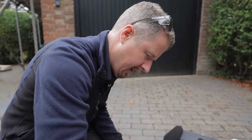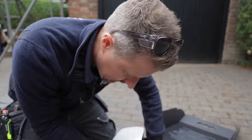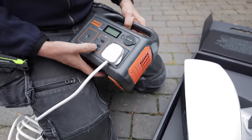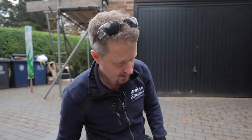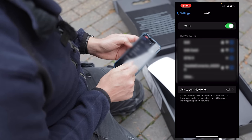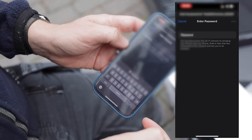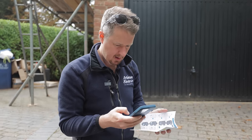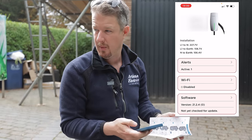What I'm doing here is putting it on a plug top so we can liven it up temporarily to do the wi-fi setup, because it has been known to be a nightmare. We've got this portable power station — obviously not enough power to charge a car, but enough to power up the unit and get it paired to the wi-fi. This is one of the unique features of the new gen 3: it has wi-fi connectivity. When you power it on it creates its own wi-fi network, which we connect to, then type in the IP address, go into wi-fi, and connect it to the customer's wi-fi network.